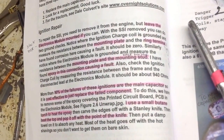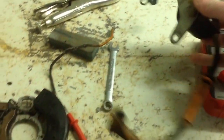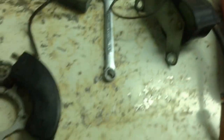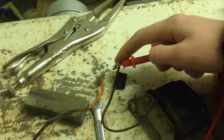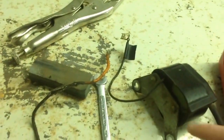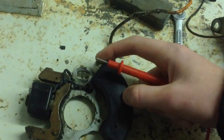Here we go, I'm going to turn a little bit so you can see better. You can pause that and check that. To check the top part — which is what a lot of people don't know how to do, because it's not very clear — you're going to take one of your terminals and check the wire that you plug in from this wire here that comes out of the back of it. That plugs into the prong on the side of the electronics module.